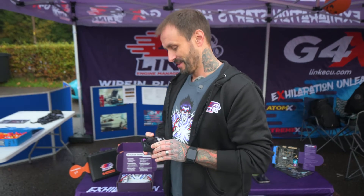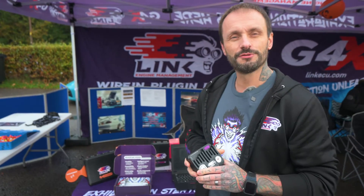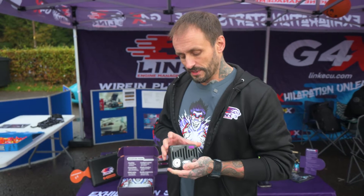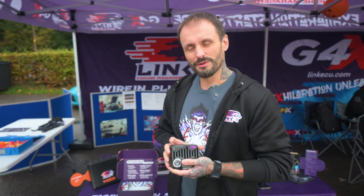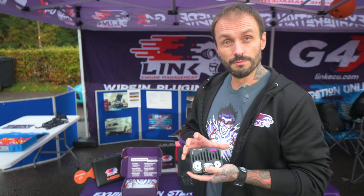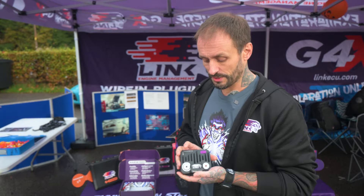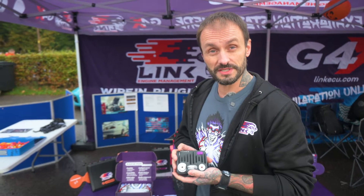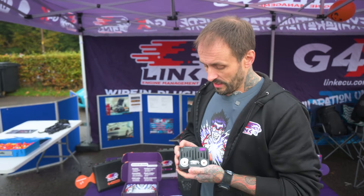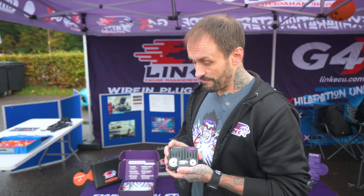You're going to ask me what do I need a PDM for and what's a PDM? I like to think of a PDM as a bit like your smart meter at home. It will replace your fuse box and all your relays in your car. If you think of your fuse box, it's quite a dumb system with all those relays — it's only on and off. The PDM, like your smart meter at home, will let you monitor everything going on in your car in terms of power distribution. You'll be able to see what's going on, what's coming in, and log it via CAN.